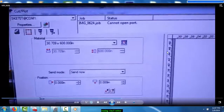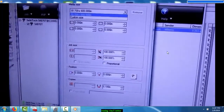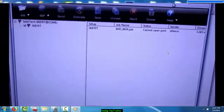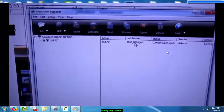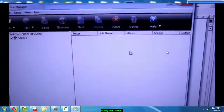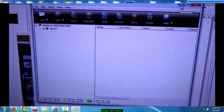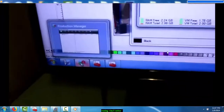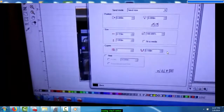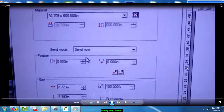If you notice there's something in there, that means it already sent a job to this machine. What you need to do to empty the memory is go here and click on Properties — it's gonna open right here. Click OK so it doesn't move out of your way. Right here it already sent a job and nothing happened. Select it, go here, and empty it — delete it. You need to do that because right now the vinyl cutter thinks you already sent it a job, but the ports were not set the right way.